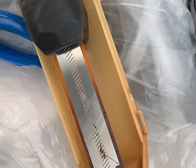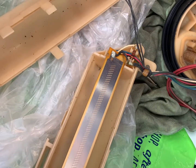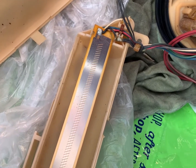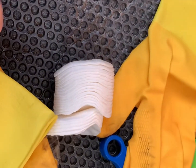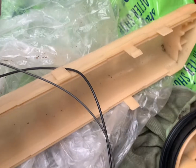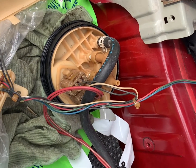Mine was reading permanently empty and the bottom does look the worst. Looking inside there's a bit of gunk there, so hopefully by cleaning all that up — maybe it was moisture — that's why it was getting stuck on empty. What I've got is some cotton pads and some acetone to clean the float and both the front and back of the sender, then check everywhere else and give it a clean up. We'll reassemble it, and fingers crossed the fuel gauge works.